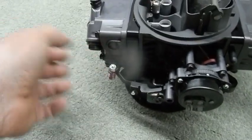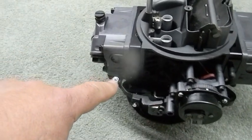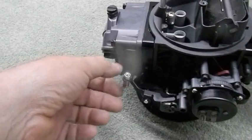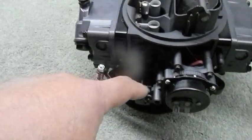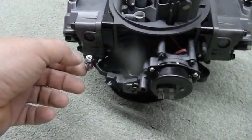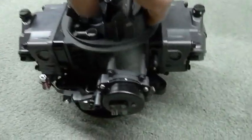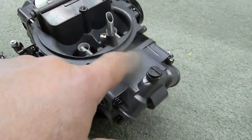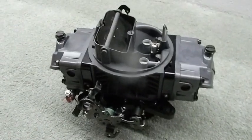I'm not showing you this because it's out of adjustment — it's clearly out of adjustment — but the problem is the threads would be below the locking part of the nut to make this actually touch. That means there's nothing wrong with the carburetor body; it means this lever is bent. So it's not a matter of adjusting, it's a matter of taking this lever off, re-bending it, putting it back on, and adjusting it. I think the person returned it because of what they saw here.